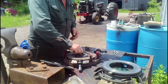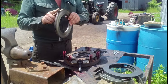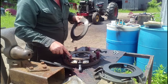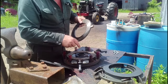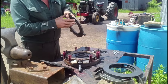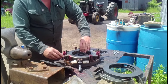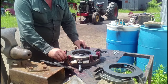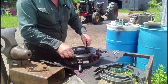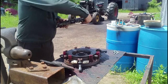Make sure you put the replacement disc in the same way as the original disc came in. It's not hard to tell which way the old one is in because it's pushed pretty hard from the transmission side, so it's easy to tell which way it goes in. Start off with the intermediate pressure plate — each one of these tabs goes on top of the set screws around the pressure plate; they are what actually activates the pressure plate. Then look for your identifying marks and line it up with the marks you made on the pressure plate. Then your Belleville washer, and again line up your identifying mark.